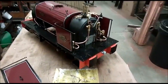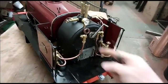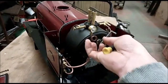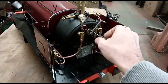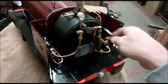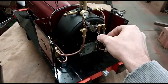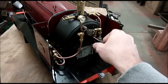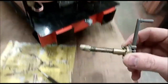Got a 2020 Alice. Today we're going to strip out the regulator - it's a very simple job. You've only got four stainless screws where the regulator is, then the whole thing slides out as a unit and we can take a look at it. Just undo the four Phillips screws that hold it in place. It's slightly spring-loaded, so there we go - and that's the whole regulator as a unit.